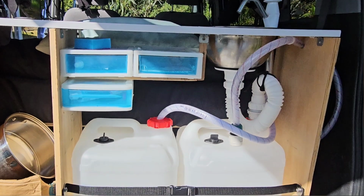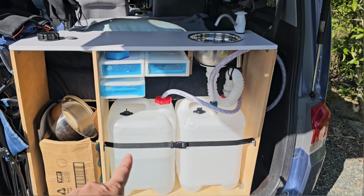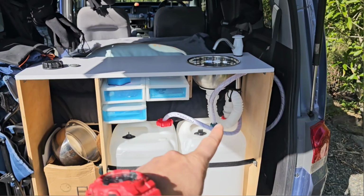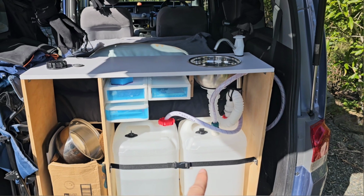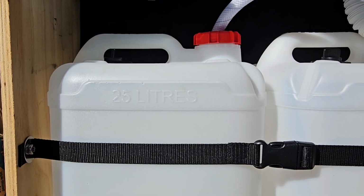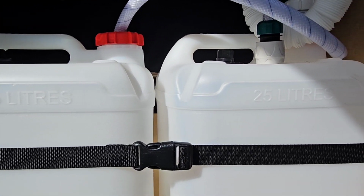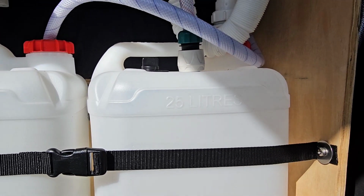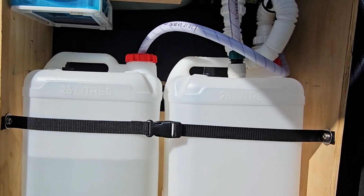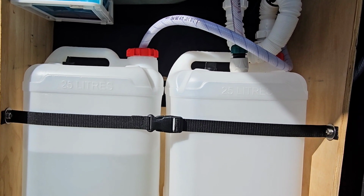It pumps water from fresh water tank and flushes used water, grey water, to wastewater tank. Both tanks have to be at least 24 liters for two-seat vehicle. If you have more seats, plan accordingly. This is a guide for a smaller self-contained car.